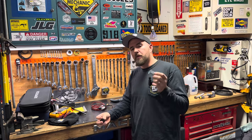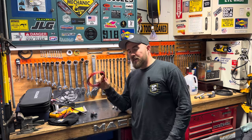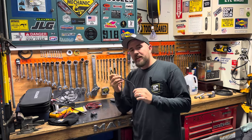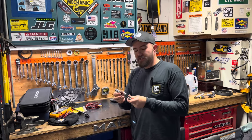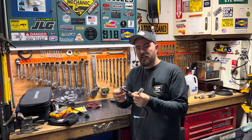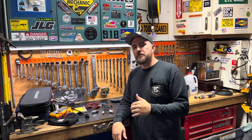We have a factory 12-volt outlet from a 2021 Silverado, the factory bezel — the part you'll see sticking out of the dashboard — a bit of homemade wiring with a fuse because we'll tap into the fuse block underneath the dashboard, and an adapter. This adapter has the factory male plug that goes right into the back of the outlet, plus an extra plug for future use. I'll link everything in the description — all parts, part numbers, and tools needed.